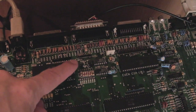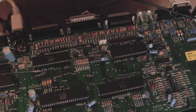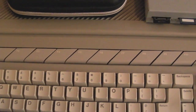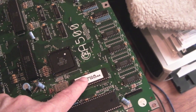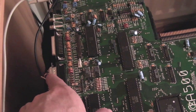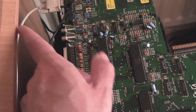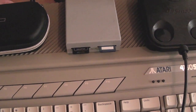At the moment I don't have a keyboard to test with, but let's use the Atari ST keyboard. You're probably thinking this guy's absolutely crazy - you can't use an Atari ST keyboard with an Amiga - but actually you can. One of the nice things with the DiAGROM is the serial port outputs. I've made a basic null modem cable - pin 2 goes to 3, pin 3 goes to 2, and a ground - connected to the ST.